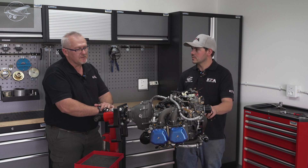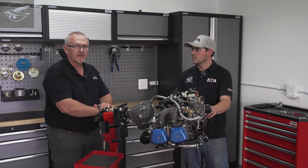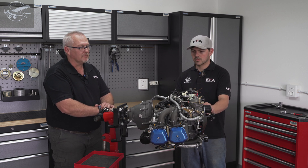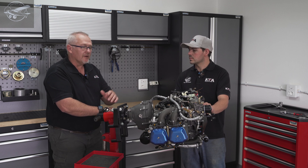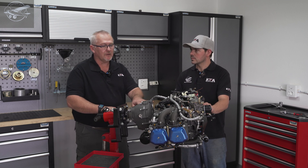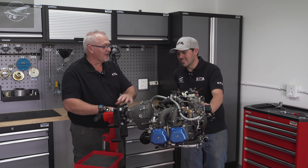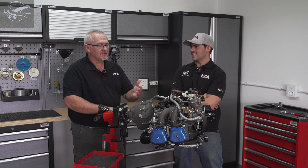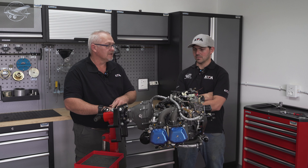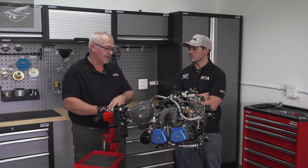Internally, we've opened up one engine, measured it up, checked all the quality, and so far we cannot find any reason to doubt the quality and reliability of this engine. We don't use the naturally aspirated 100 horsepower configuration — we actually modify it. We increase the power to 135 horsepower, which means we are making this block work much harder. And so far there are no issues with the extra 35 horsepower we are taking out of this engine.